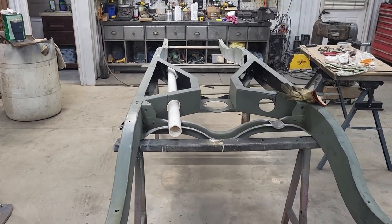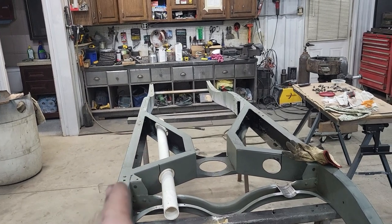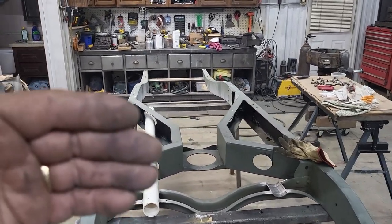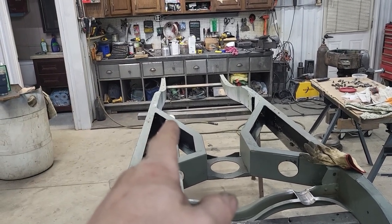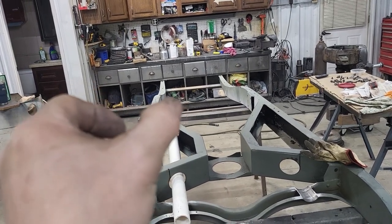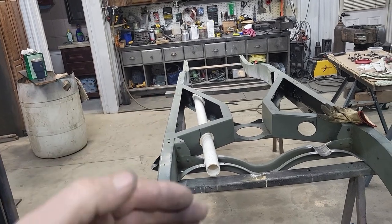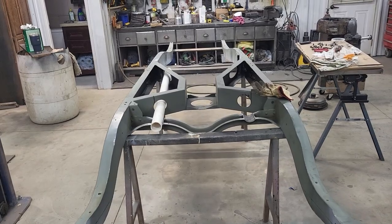I'm not going to have any interference, not going to need a kink or a bend in the tube. It'll flow back from the engine - the engine mount to engine mount is 24 inches, the narrowest point of the cross member is 24 inches. I should be able to get in and clear, as wide as the headers, with a modest transition from the header down to the tube. This will be nice and straight, catch the muffler right here, and then do my bends right there - very clean looking.